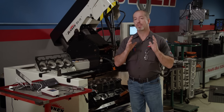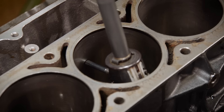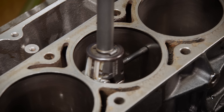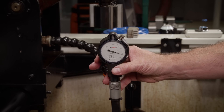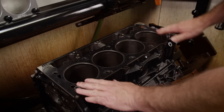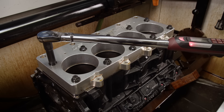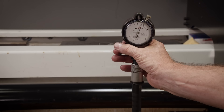No matter the design, when the head is bolted on, it distorts the cylinder somewhat. What we're going to show you is on our particular block how much it moves around when a cylinder head torque plate is bolted on. With our Sunnen dial bore gauge zeroed to the size of our pistons, we'll take several measurements along the thrust axis in the bore, then 90 degrees offset from the thrust face. Without a torque plate, it has a maximum out-of-round of nine ten-thousandths. Using the same style of MLS gasket as one will use during installation, the torque plate is tightened in three stages to a final value of 90 pound-feet. We'll repeat the measurements, getting a maximum out-of-round of thirty-four ten-thousandths — nasty!